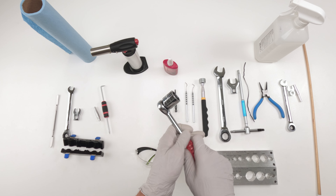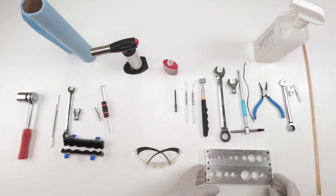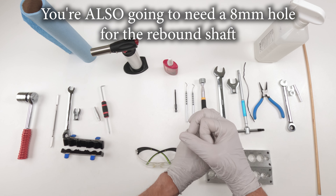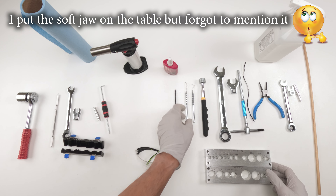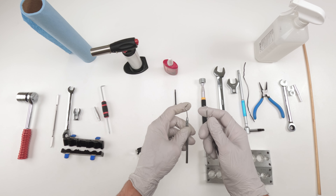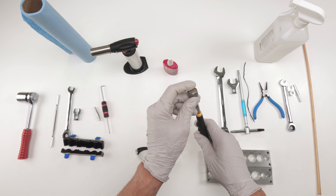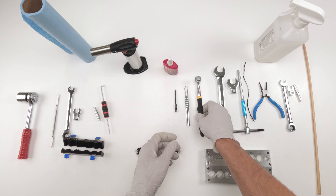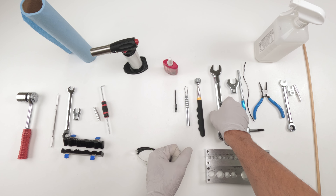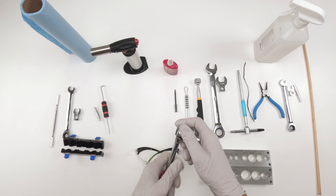Then we're going to put it into a vice. We're going to need two different soft jaws — for the body, a soft jaw with about a 15 millimeter hole to clamp down the body of the damper. Before we separate it, there is a little C-clip that's really hard to get. You're going to need one if not two very small thin tip picks to get it out, and I highly recommend a magnet — you do not want to lose that C-clip. Then to separate the damper body, we need a 19 millimeter wrench and a 19 millimeter crow's foot to torque it all back down.